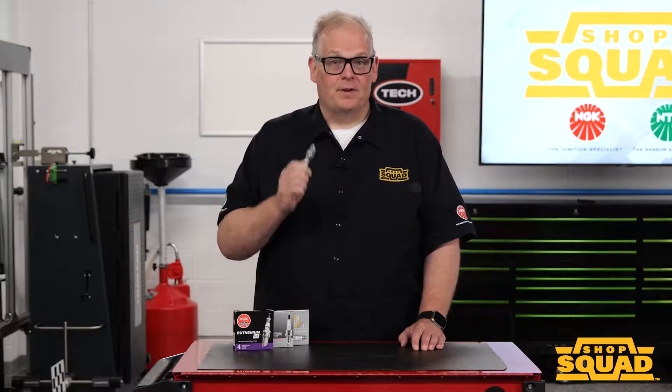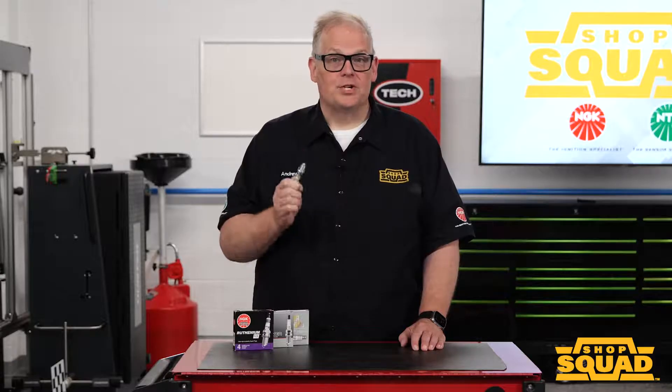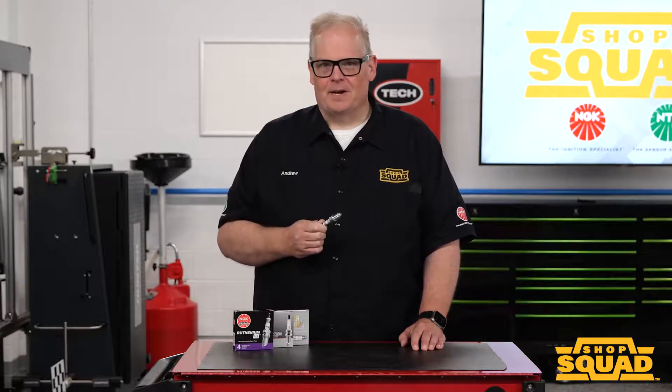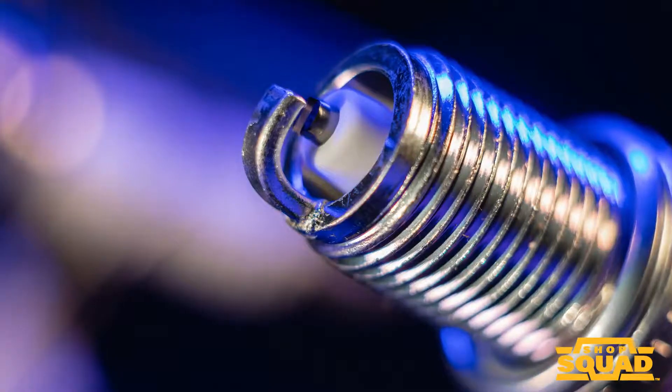You can brush off the plug and firing tip with a clean rag, then spray the firing end of the spark plug with a quick-dry cleaner such as fuel injector or brake cleaner, and let it sit for about 10 minutes. You can then use a wire brush to clean off any deposits that have loosened.